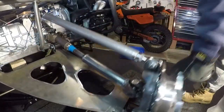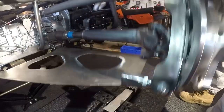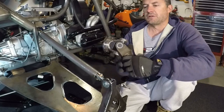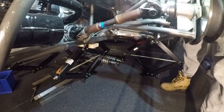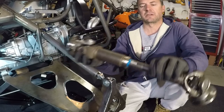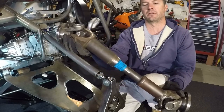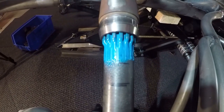What I've got going on here is I've tried to design this rear suspension so that my pivot points will be roughly where my u-joints pivot. The reason running u-joints on these bug transaxles is an issue is that when you have a swing arm setup, as the suspension comes down it pulls, and when you're bouncing along at normal angles there isn't a lot of slippage in the spline. But when you reach the further ends of your travel, the spline will actually start traveling a good distance — like if you're at full droop and then you're airborne, when you land and that suspension compresses, it's going to push that spline in.